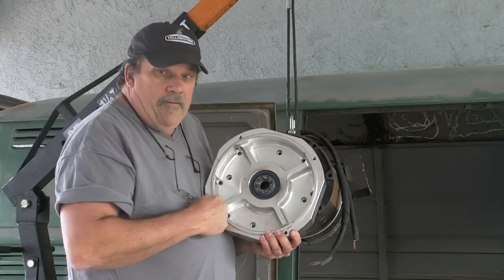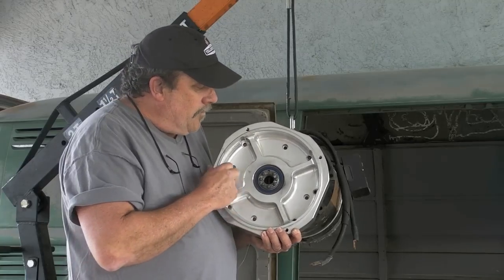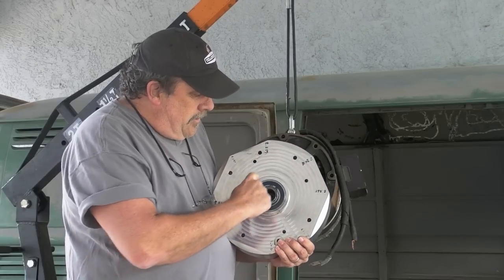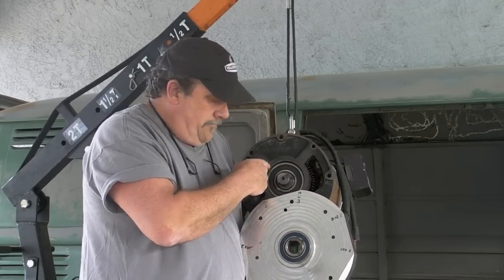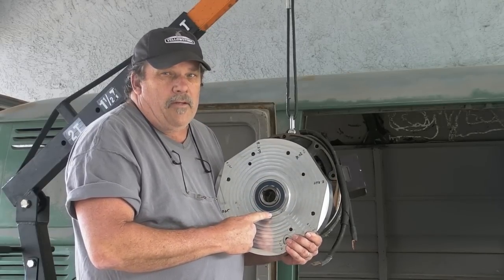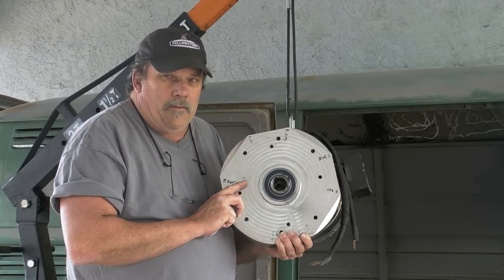It's a nice adapter plate. It's got heavy, heavy ribbing. The crank end here for the flywheel has eight pins for the Volkswagen setup. Width-wise it's no different than any of the other adapter plates to match bell housing setups. This round part here fits into an opening on the motor, and the shaft just slides right in. This is designed for all of the Warp 9 and Warp 11 motors, and also the high-voltage Kostoff 9 and Kostoff 11-inch motors, so this adapter can fit multiple motors.